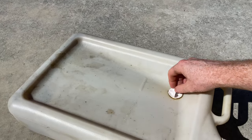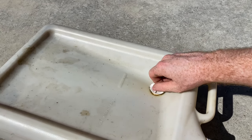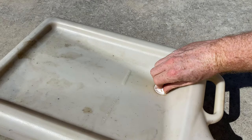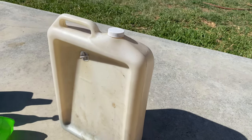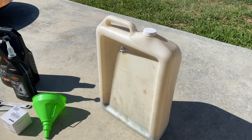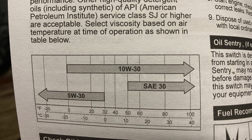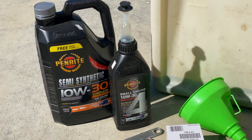I just wanted to show you these — they're a plastic can but you lay them down and use them as an oil pan. You unscrew the bung and let the oil drip in; it'll drain down through the hole. Then you do up the bung and stand them vertically. They're really good around the garage where you don't want to make a mess. In terms of oil, in my climate I use 10w30 for most lawn mowers and small motors, but it is climate specific — I'll flash up the manual if you're in a colder or warmer climate and might want a different oil.